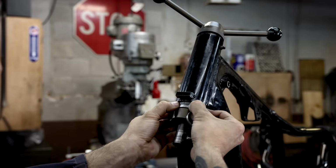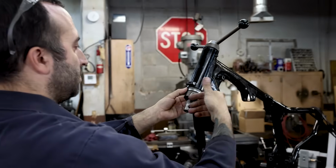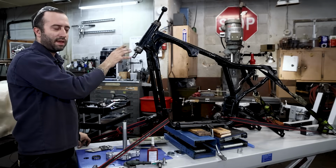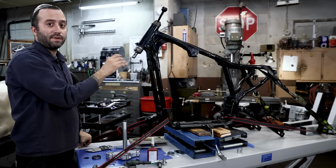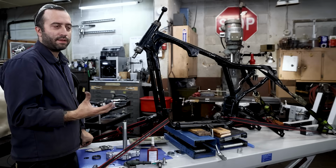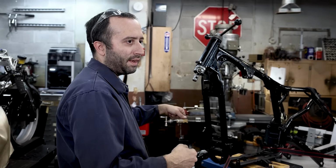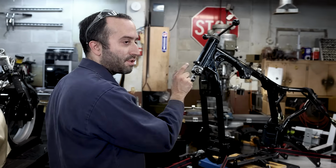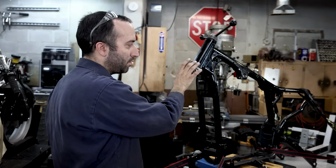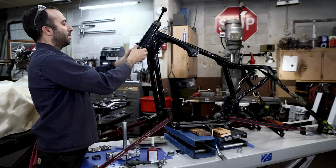It's really close. And like I said, we're just going to get this press started so it stays, and then I'm going to take it off so I can actually see the tang in the back and verify that it looks very centered from just visually inspecting it. It'll be really hard to tell until you actually get the bars on to see where they hit the stop left and right to make sure it's centered. But do your best to get that tang as centered as possible in that rotation. Taking your time at this would be your best bet.